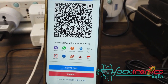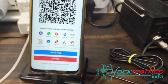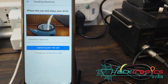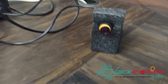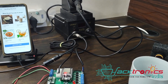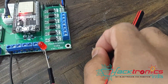It says: 'Please complete the payment to enjoy your drink. You can pay by scanning the QR code using any UPI app.' It supports UPI and also RFID. In an office setup, employees can simply tap their RFID card instead of scanning every time. There is also a cup detection sensor - as soon as you place the cup beneath the pouring spout, it will dispense the beverage.